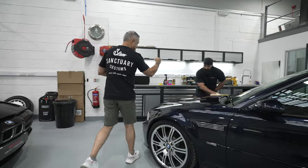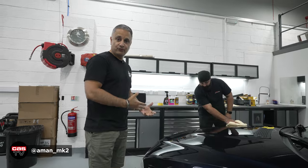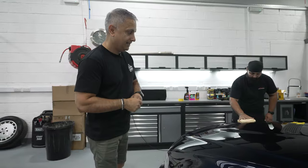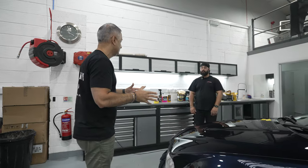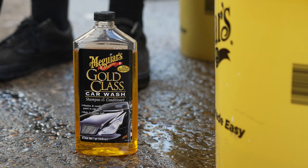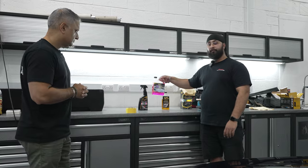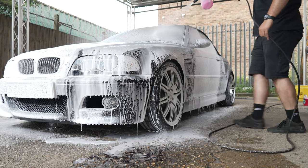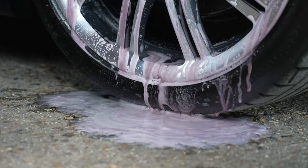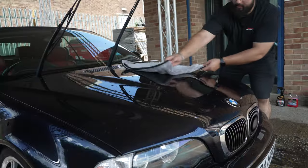Amun, what are you saying? Hello, how are we doing? Not too bad, thank you. So Amun's new to CAS — he's been here a few weeks. We introduced him earlier on CAS Unplugged episode 13. You've given it a quick wash — what did you use in terms of wash products? We stuck with Meguiar's — we've got Gold Class car shampoo, just a good super slick shampoo, nice for safe washing. Prior to that, we used some snow foam just to get rid of as much standing debris as we could. For the wheels, we used Meguiar's all-wheel cleaner, which is a good iron fallout remover — makes washing nice and easy. Then dried it using a Meguiar's drying towel. And then we're inside now.